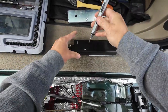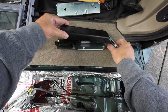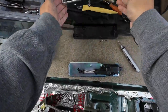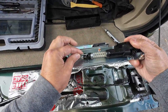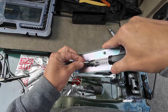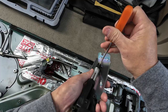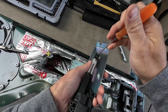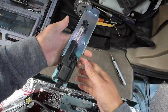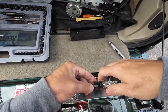The cover comes off like that. On my other one, this piece right here sits in this hole right here, and I broke it off trying to take it off. What you want to do when removing this is put a screwdriver in there like this and twist it — once you twist it enough, this will pop up and you go back over on the other side, push this the rest of the way through and it'll pop up without breaking these. I just got fed up and broke it — that was my fault. Basically, this goes in the hole just like this.